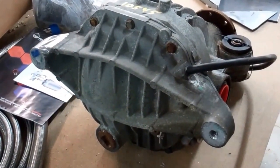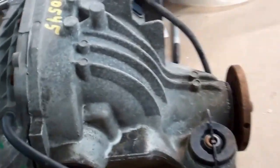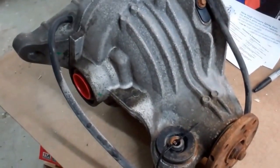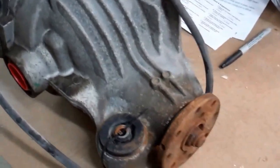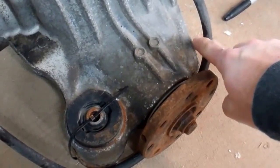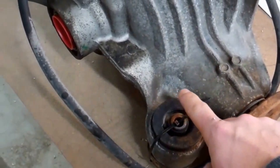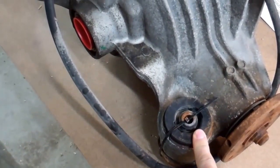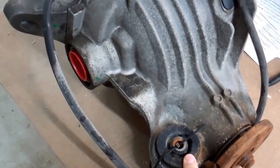Right here is our victim — the Ford 8.8 independent rear suspension differential. This one, and the kit as a whole, works with the differential that comes out of the Ford Explorer. I think it's 2002 through 2005, maybe 2006. The key difference is as you get later in the models, they add another mount over here. Some people have tried to make that work anyway, but you're going to end up with a lot more headaches. The 8.8 IRS has the single front mount on the snout. It was also available in the Mercury Mountaineer and whatever else Ford decided to badge differently but still produce the same vehicle.